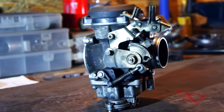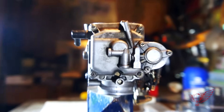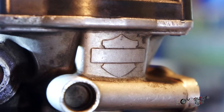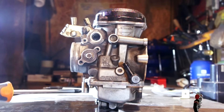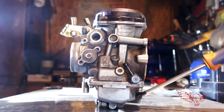I've taken off the carburetor so that I can show you exactly where the screw is located — on the bottom side, right between the fuel bowl and the opening to the manifold. I have the original Harley Davidson carburetor that comes with this bike, but this process can be applied to pretty much any CV carburetor out there. The only important difference is that some carburetors will have the screw located on the opposite side of the carburetor body, between the bowl and the air intake. In that type of setup, the adjusting screw regulates the amount of air in the mix.